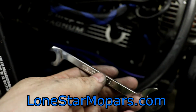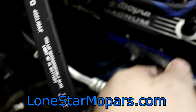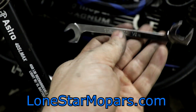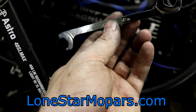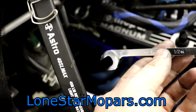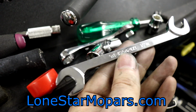perfect for the headers. And what I mean by that is, when you come in and you get to these, like this guy is really hard, the second bolt off of cylinder 2, and then our 5th bolt in front of cylinder 8, those are stupid difficult. And what you have, this wrench is just long enough that you can come in and catch it great with the angle head, but then as you come down you hit the primary, and that's where the stubby's really nice, but then again you don't have the angle on it, which makes the stubby kind of cumbersome. If we could take this and stubbyfy it, basically cross this with a little SK there, it would be such